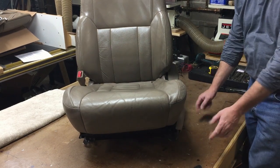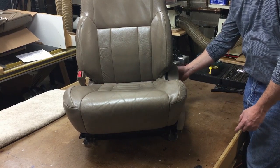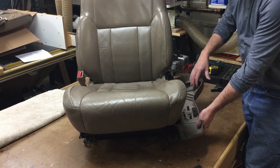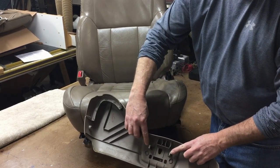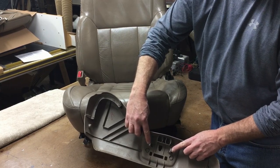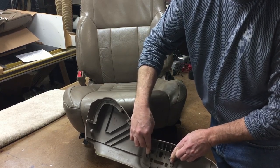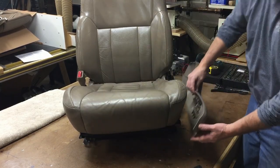The power button side is much more painful. There's 1 Phillips screw back here. There's a couple of areas of contact back here. And then there's 2 of these clips. You can see this one's broken. I ended up breaking it off. I'm about 60% success, 40% failure on taking these off. If you can push these 2 things together, it's just really hard to get to them, you can get them off. And then on the front, there's just a slip.